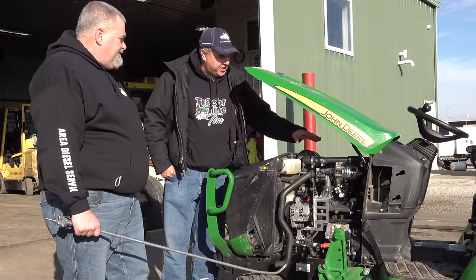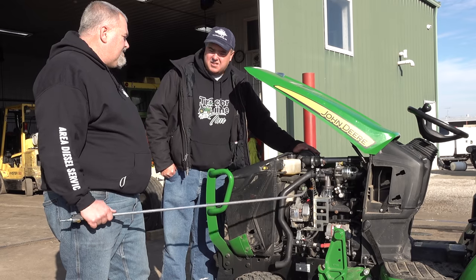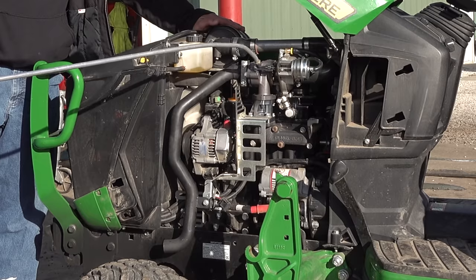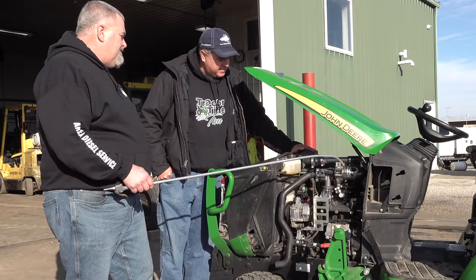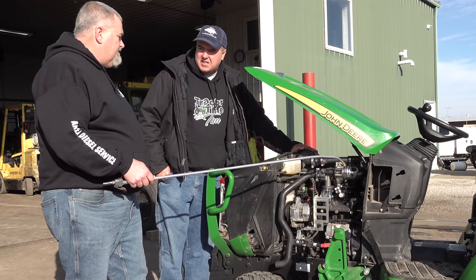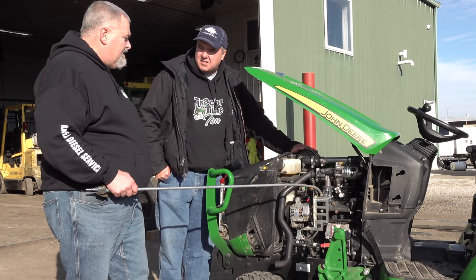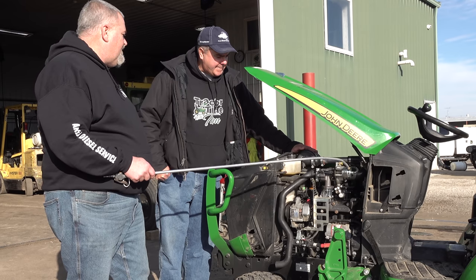So the objective of the whole thing is to put a little higher air pressure on the intake side, into the engine. And we can control the speed relatively closely of the rotor group, the turbine and the compressor wheel, by the wastegate actuator, through this linkage to a wastegate flapper that's in here. The purpose of the wastegate is to maintain the speed of the rotor so it doesn't go into what they call overspeed and shake itself to death. By being able to adjust this, we can also help save the motor by not over-boosting the engine. We can run this particular actuator down to about 3 pounds or adjust it up to about 14 pounds.